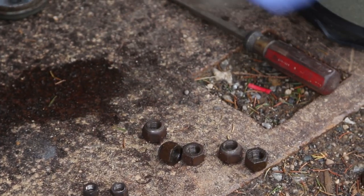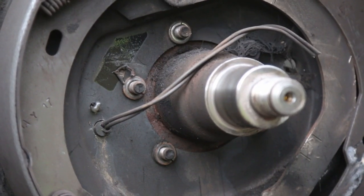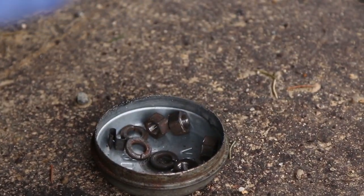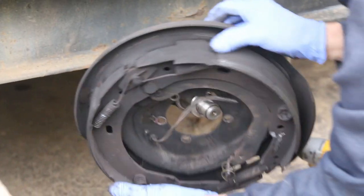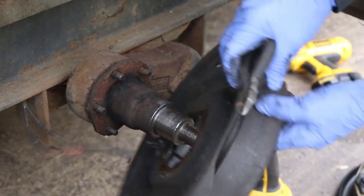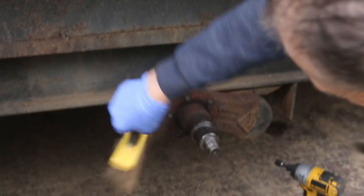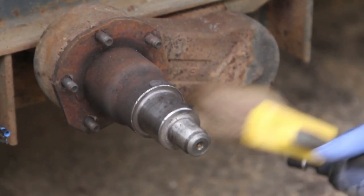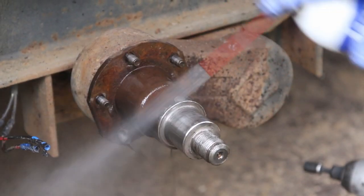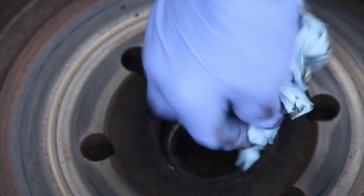You're going to have to unbolt these bolts here to remove the old brakes. An impact wrench will get them out. Then you have to remove these lock nut washers. Now you can remove the old brakes. There are two wires attached — I'm just going to cut them off because I'll be reattaching them again.